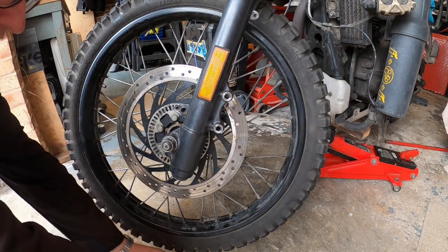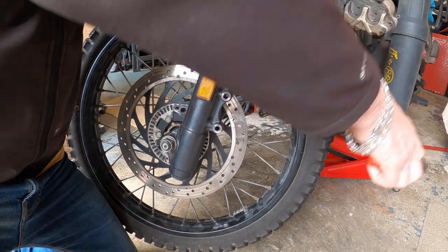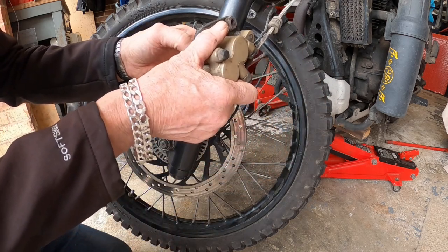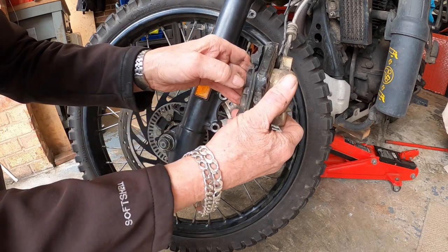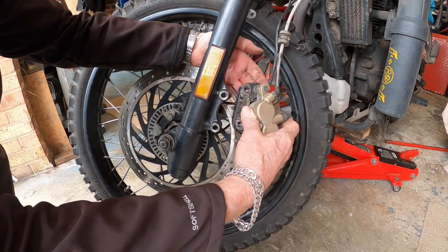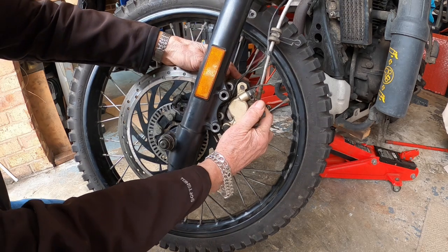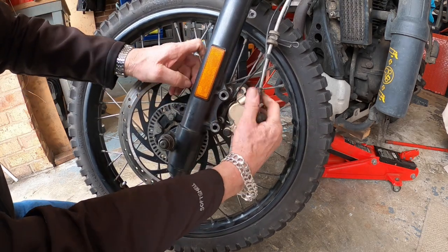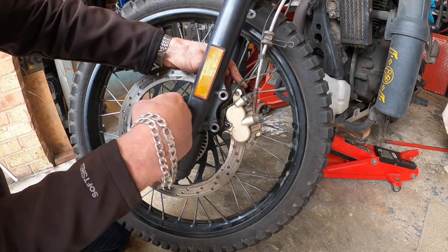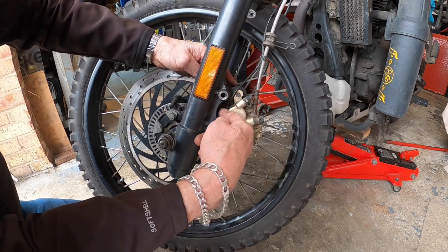Right then, next thing is the brake caliper and the sensor, this sensor here. So pads are okay. Just make sure your pads have the gap between them, so your disc can go in there. This, I do believe I put this goes in there. That's the caliper on, and I run this between the two caliper mounting bolts and the fork leg, so that keeps it out of the way really, rather than running it round there or on the inside where it can get snagged. So it comes down here, just tucks in between the two mounting bolts. There's plenty of room behind there.